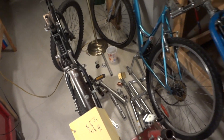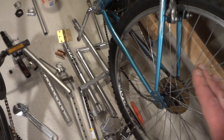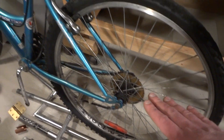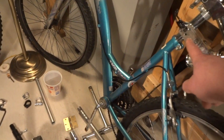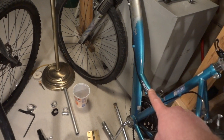Most setups use a spring, which is totally a bad idea — a spring is not a universal joint. Also, when connected to the rear axle, all the weight is forced down on that point because the trailer sits lower, loading the rear. With a seat post hookup like this, the load is brought toward the middle of the bike, spreading weight toward the front axle — which is what you want.